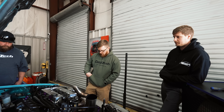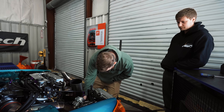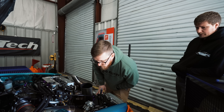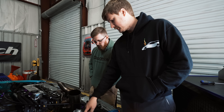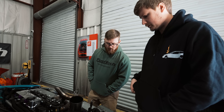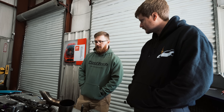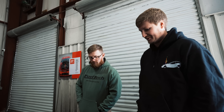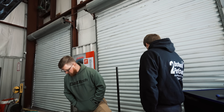It is a compressed air car — it's got an actual air compressor and tank in it. That is the leader for the internal slave cylinder. The only thing I don't know how to do is how to set up the slipper valve. It's not plugged in right now, but everything's wired to it. It's on a yellow output. There's a couple different ways you can do it: generic duty cycle output or progressive nitrous output, so it's enabled while it's on the two-step, and then you can basically PWM it out over time — or by speed or whatever you want. We didn't want it to be on all the time in case he had to clutch it at some point and it'd be dragging at 140 miles an hour. We'll set that up later.